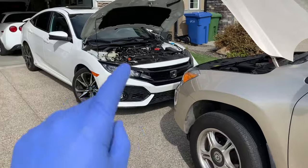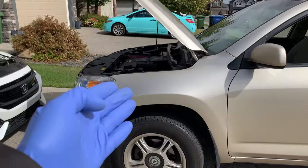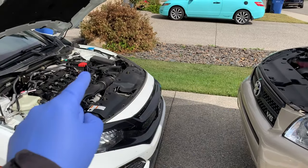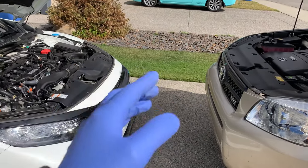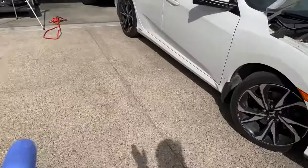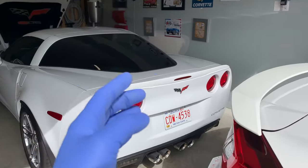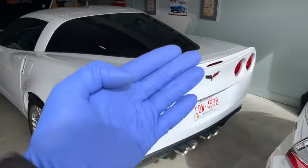Let's start by preparing our vehicles. There's our disabled vehicle right there. What we ended up doing was moving our good vehicle close enough to it. You want to have somewhere around two feet or so in between so you have enough walking space, and you want to make sure that your jumper cables are long enough to reach post to post. You're not always going to have this particular situation where you're able to put one vehicle in front of the next.